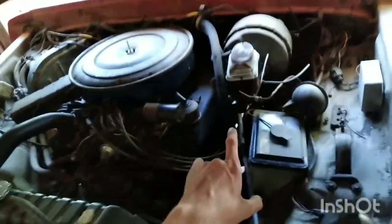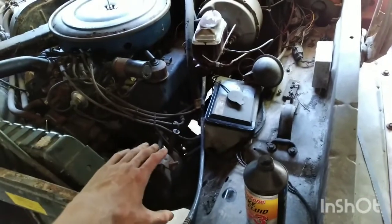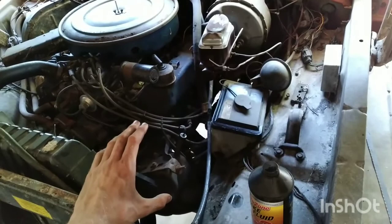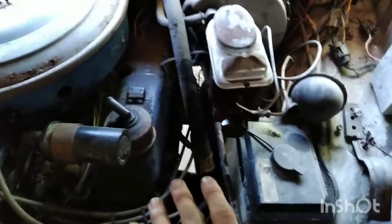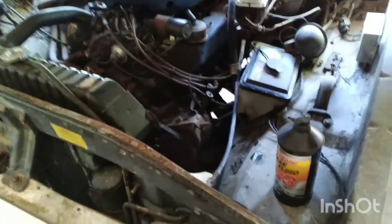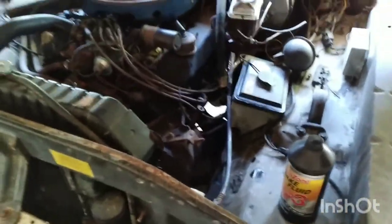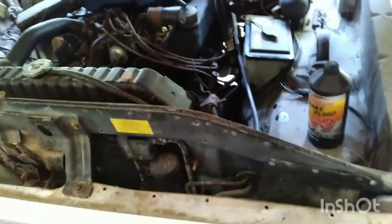The first thing you're going to do is make sure you've got plenty of brake fluid and that your cap is off. On some older vehicles the fluid can come back up, especially if there's air in the system, so just set the cap on loosely so any air can circulate freely while we're letting the air out. It's pretty easy — all you're going to need is two people to bleed the brakes, your brake fluid, and a wrench or two depending on whether the front and rear are different sizes.